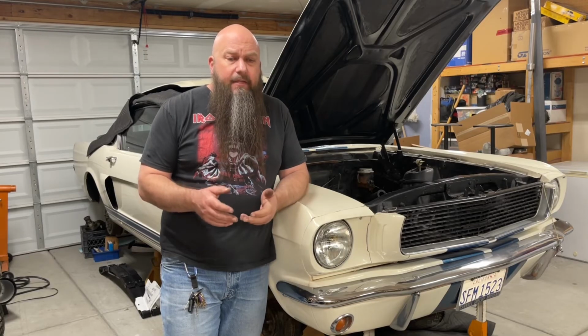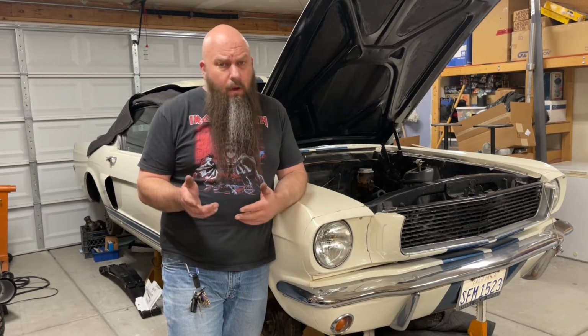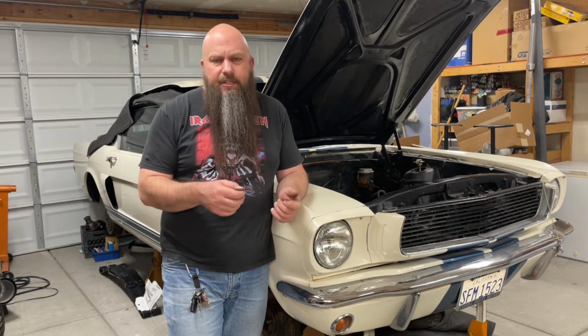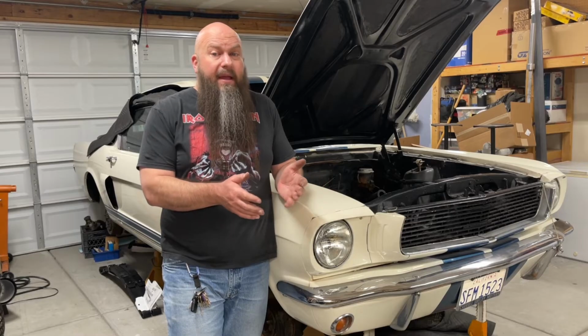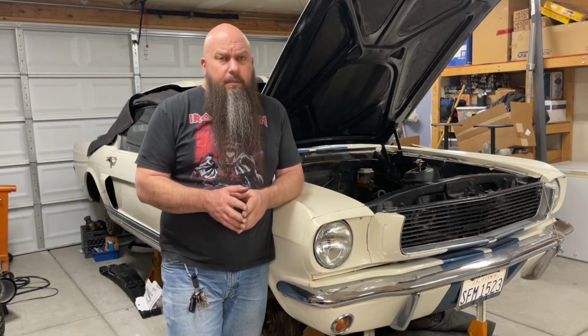You know, the advanced mechanism might not be right underneath the distributor rotor, but let's be honest, it's not that much more complicated. You can change the springs to adjust the curve on a points type distributor or a Duraspark type distributor in typically about a half an hour. Yeah, that takes a few minutes longer than changing the springs underneath the rotor and changing an advanced bushing. But the difference between having to buy a $400 distributor and buying less than $40 in parts and tools is pretty significant.